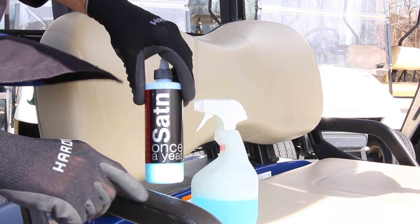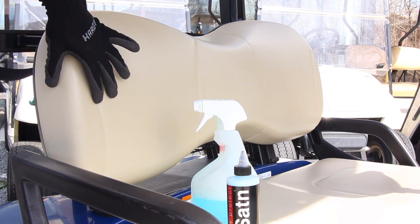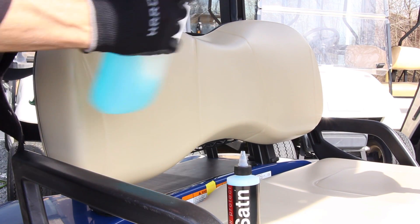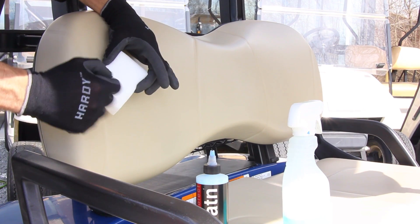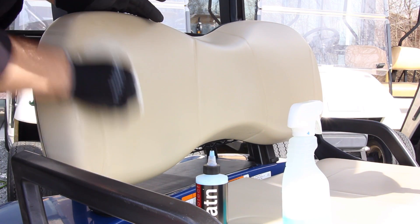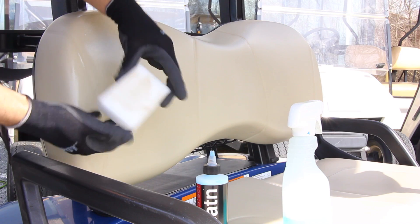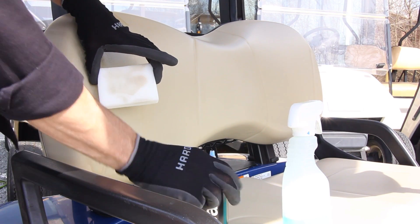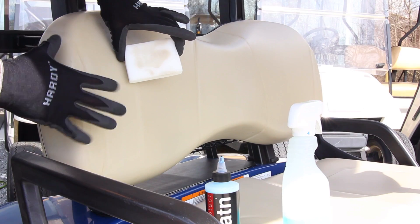By the way, that is one coat of the black to restore the plastic there. Before we treat this vinyl — vinyl has a skin on it, a layer which is quite porous, which is why it gets dirty and stays dirty. My favorite trick: after a general cleaning, use a general cleaner and one of these little dense foam cleaning pads, which you can get quite cheap online, and clean it again for a second time. You can see what I'm literally pulling out of this porous surface. So once we get it clean, we're going to seal it with satin and it won't be an issue again. Satin will lock over and not allow dirt to penetrate the vinyl, and of course it's going to protect the vinyl against UV.